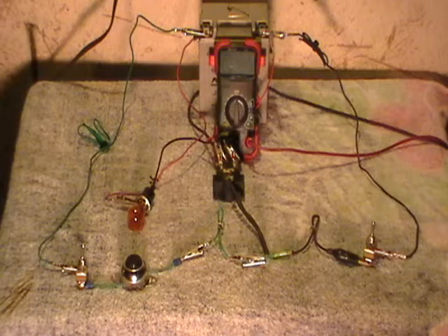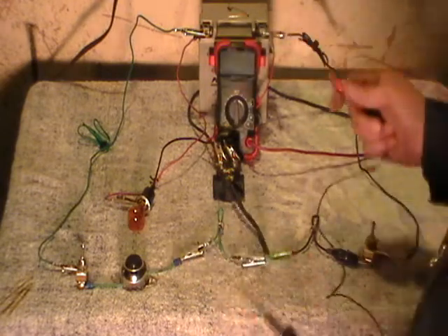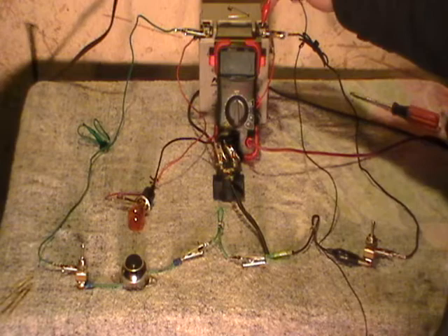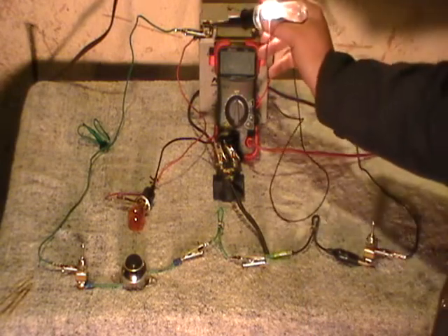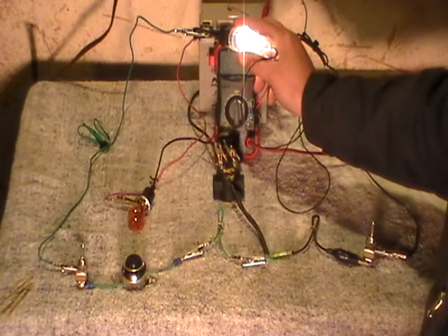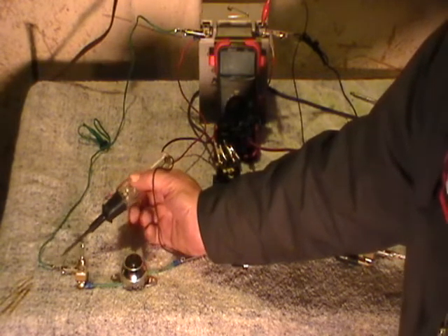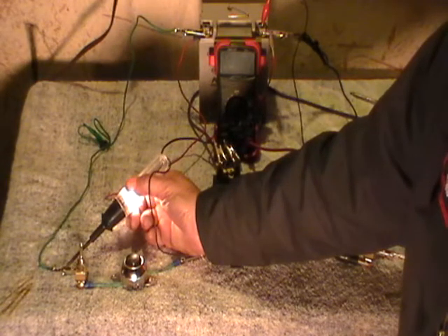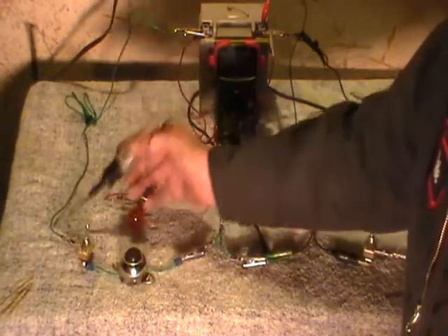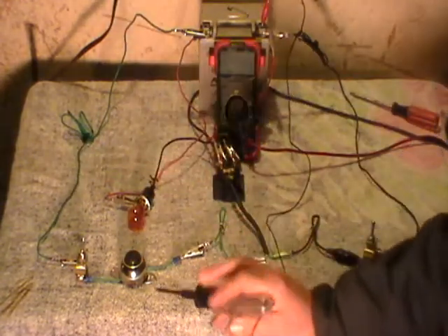To check continuity, I don't need a lot of sophisticated equipment — a lot of times I'll just use a simple two-dollar test light. First, I'm going to test the ground side and the two switches. I connect my test lead to the positive side of the battery, test my equipment to make sure it's working, then touch it to the negative post of the battery. From the negative post, I go to the connector, then to the first switch — the clutch switch. If I have good continuity, that means from switch to ground we're okay. If there's no continuity, I know there's a break in the line and I'll trace it back and forth until I find the breach, repair it, and continue testing.